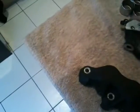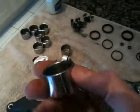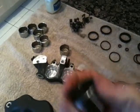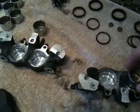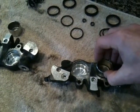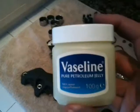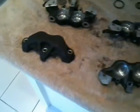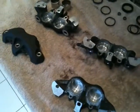And then the piston pots, I've given them a nice gentle scrub, because you don't want to score them. But the main bit is this top bit, which is the bit which pumps in and out. So you don't want them getting cruddied up again. So clean them all off. And according to my mate, who's been mechanicking for years and years, you smear that over the rings and in the grooves and on the piston pots. You slide it all nice and back in, and then I'm going to connect them back up together, and I'll show you the next stage.